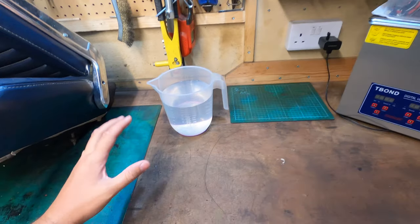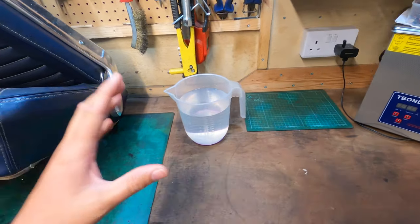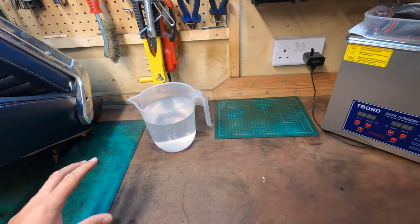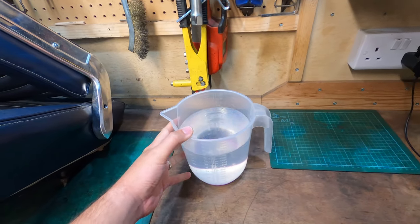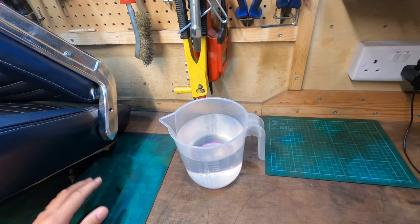My current situation, I think it's not the best approach, but buying that cowl repair kit where you basically get two plastic buckets and put them up on the underside, that is probably the way I'm going to go, which isn't ideal, but it'll work. So let's go out to the Mustang, let's inspect the cowl, remove all the debris, try and get it as clean as I possibly can, and then just for a laugh, let's pour some water down and just see how much comes in the car.